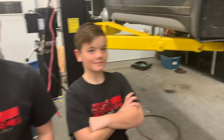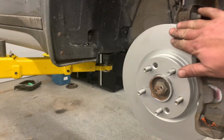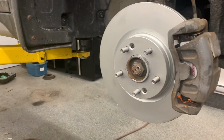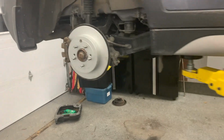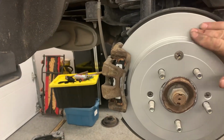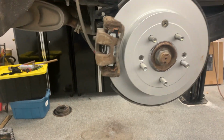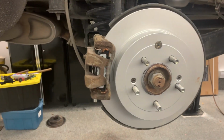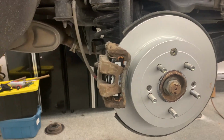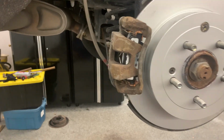Those two young boys, they've done the Tucson brake job. So, nice rotors, AC Delco Professional Series with the element from Raybestos for the brakes. Same thing for the rear. Those are coated AC Delco Professional Series with the element. We've made sure to put anti-seize behind the rotors, clean the slider, and put some ceramic lube on it.